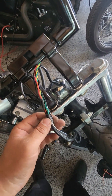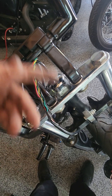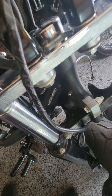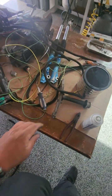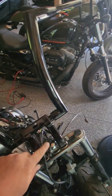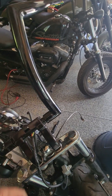This is why I told you not to cut off the sheathing — you just split it open, tuck all your stuff in, make it nice and pretty, then tape it up and you've got a little more protection for your wires. Then I'm going to run the excess farther than needed and add some engine sheathing I got out of the trash. Another technician was going to throw it away and I grabbed it. I'll run that sheathing down over the wires for extra protection.